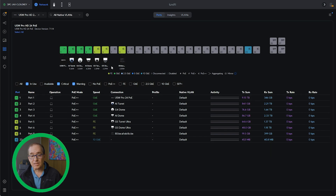I don't have it in the rack right now — it's up on a different workbench testing out cameras. I've been testing the AI port and playing around with every different camera, and it's really nice to plug them all in at once without worrying about connectivity issues. I do have the E7 WAP in one of the 10-gigabit uplink ports — you can see the light blue indicating 10-gigabit. Once I'm done playing with this switch, I'll put it back in the rack. We're about to do a total refit of our server closet rack. This is replacing a Pro Max 24 PoE, but I really like not having to think about whether anything is 2.5-gigabit.